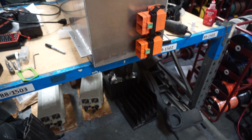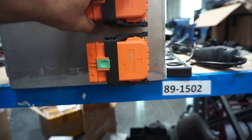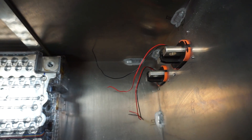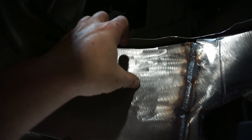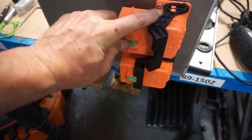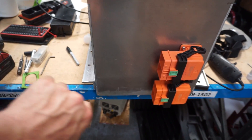After a bunch of chiseling, drilling, and tapping, we've got the high voltage disconnects all mounted up on the side of the box. They look pretty nice and uniform. However, I did screw up - these were supposed to be almost touching and there's about a quarter-inch gap between them. That just means I have to clearance a little bit of the flange on the body, which is not a big deal. We did tap the aluminum, so these M5 bolts are tapped directly in and Loctited. When we want to remove this box, we just pull this down, open this up, and it slides off - that'll be our high voltage connection. We'll have two wires coming out of here to our motor.